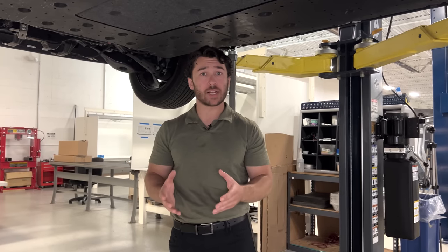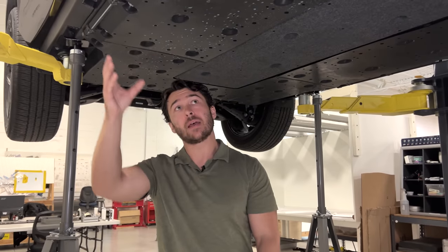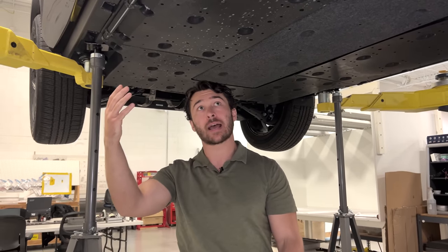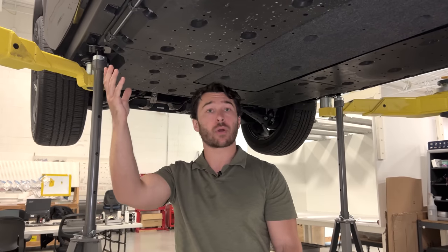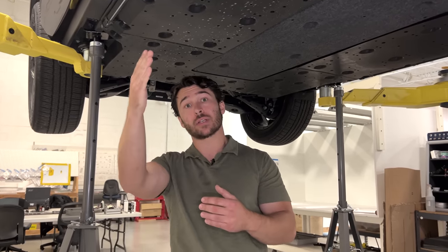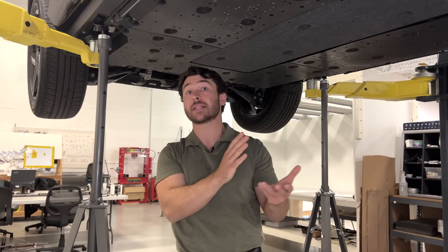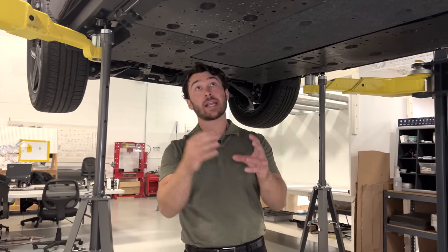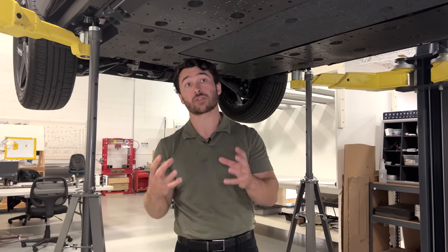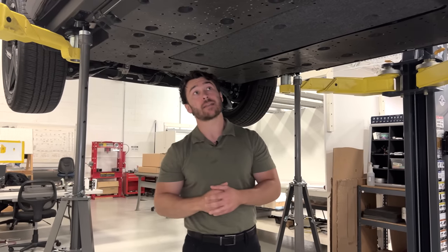It's a really elegant way to do it because you have very limited space in this area. And no matter what, for a side pole or whatever structure you're going to have there, you do have to run the coolant fore and aft anyway. If anything, that allows you to, rather than have the coolant line be in between your rocker section and the structure on the side sill of the battery, integrate it, and I would wager that you could garner more structure that way by being able to build your structure around that coolant line.